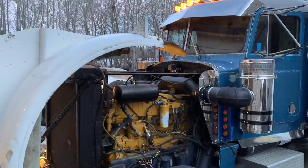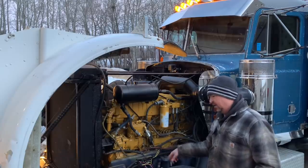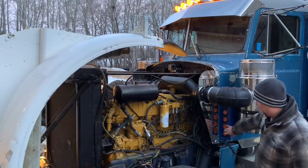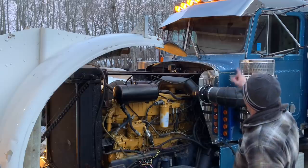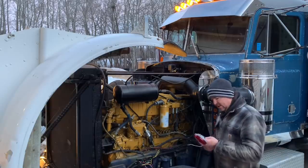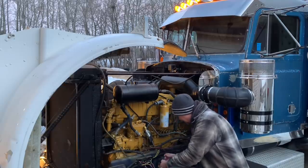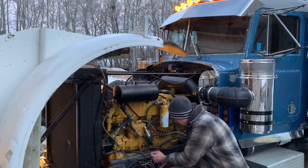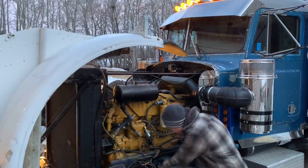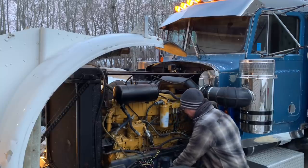Now I'm trying to figure out a couple things. This is the box where I terminated all the signal lights and headlights last year. I've noticed I've lost my clearance lights on the air cleaner, something's going on there, but the roof lights still work. So I'm going to test and figure out what's going on. For testing I bought a spare light - you put the ground on there and then you can see which one gives you what. There are our clearance lights, so the second pin in is hot for clearance lights. Now I'll do the same thing with signals.